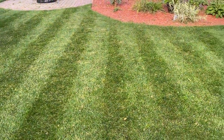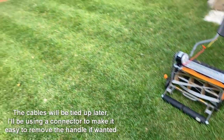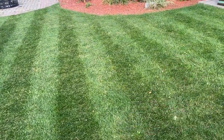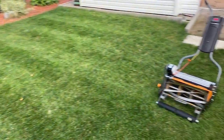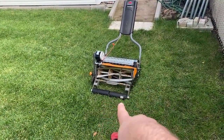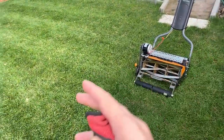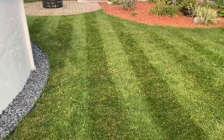Here is the first test after changing the rear cylinder. With the roller back on, the cut is not as even as before because I overseeded this area and let the grass grow a bit too much. Reel mowers are not well known for cutting long grass, especially with a front roller. If you use the wheels on the side instead, the cut will be super clean. What the front roller does is avoid scalping and help you get harder lawn stripes.